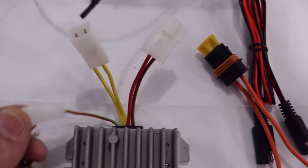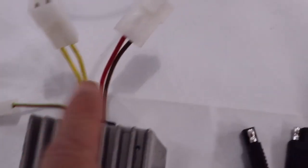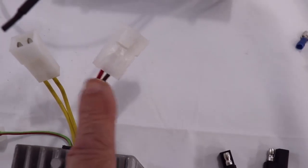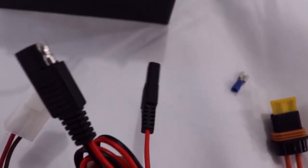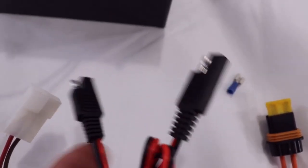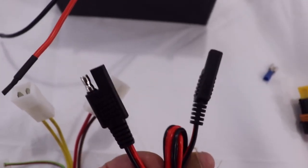The red and brown leads go to your charging circuits in the battery. There is another wire, but this wire is not used. What I do is cut off the plug that comes on the regulator rectifier and install one of these two-prong connectors, which you can normally buy at an auto supply or trailer supply house.